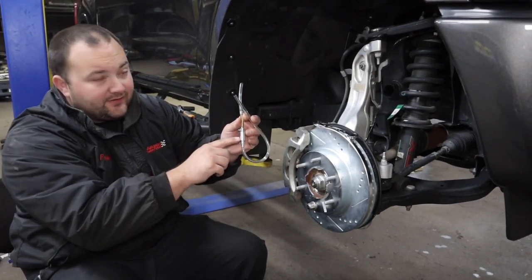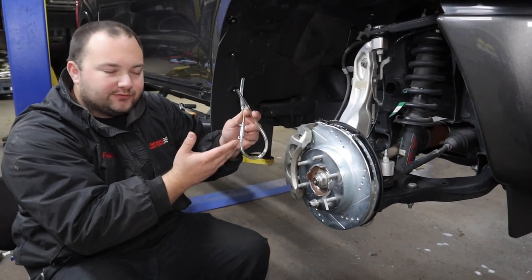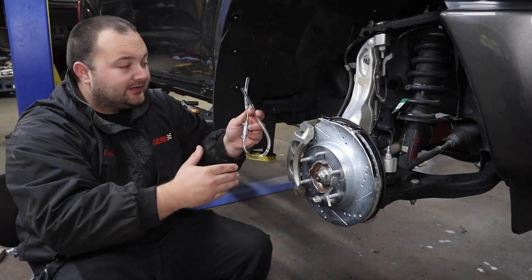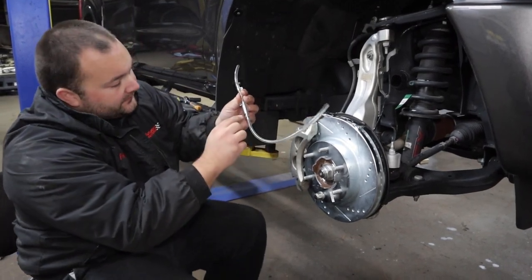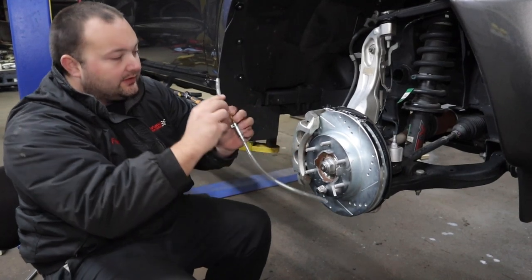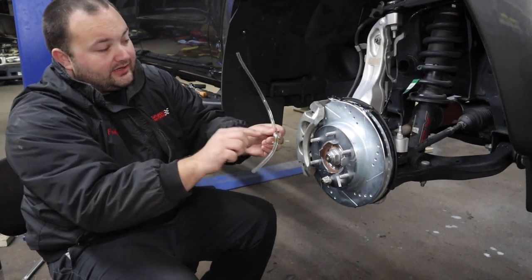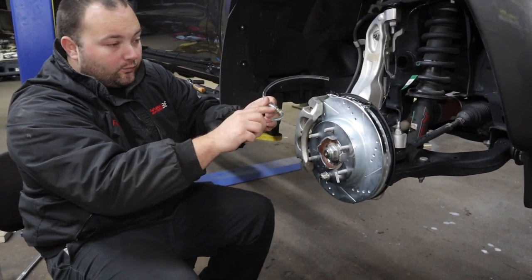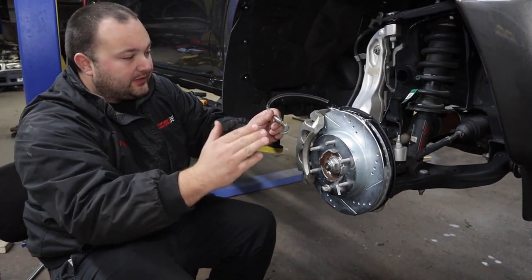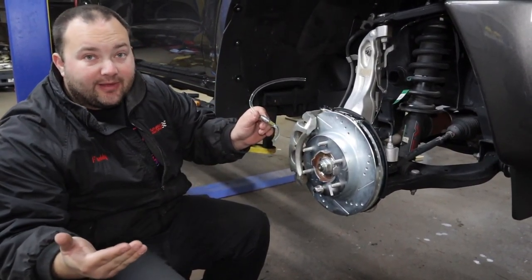It's very simple — it's got a check valve in here and there's some kind of pre-loaded pressure going on with it. You can't put your mouth on here and blow through it; it takes pressure to actually force through it. There's an arrow on here that shows the flow of the fluid. The arrow is pointing this way, so you put this end on your brake bleeder, crack it loose, and because there's some pressure here, once you crack the brake bleeder it's not just going to start leaking out and put air back in your system. You actually have to push on the pedal to force it through, and then it'll close shut and won't let any air back into your system.